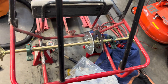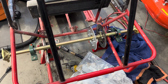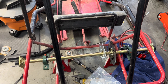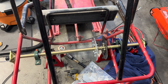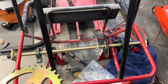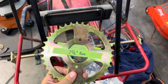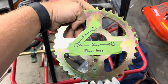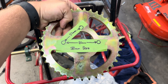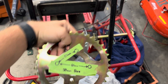It comes with a 530 sprocket. A 530 sprocket is pretty big, and if you're doing a go-kart, good luck finding a clutch or torque converter with a 530 tooth on it. So I adapted it. It has a 2-5/16 bore, which is also 58 millimeter — 80 millimeter across and 57 millimeters side to side.